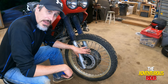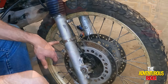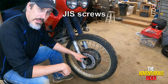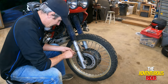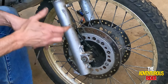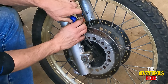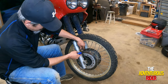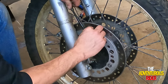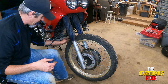Now that we've got the two brake calipers off, the next thing we need to do is take our speedometer cable loose. Take your hose clamp loose and also your actual speedometer cable — both of them are JIS Phillips. To get the speedometer cable out of the housing, you just pull it straight up, then wrap it over here out of the way and let it hang loose.